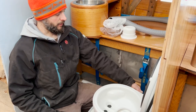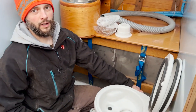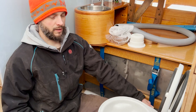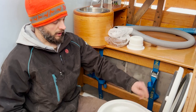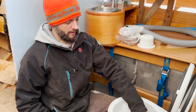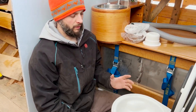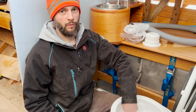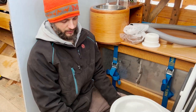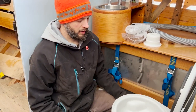And how this works is there's a lever here and it opens or closes a compartment. So if you are equipped with a central hose attached to your body and you want to come and use this bathroom to go number one, you can leave this like this. And if you urinate on here, it gets directed through a gap and it goes into the pee jug. How this head really works is it's separating the liquids from the solids. And if you are to sit, then it ends up going in these forward drains. But no matter how you use it, the idea is the urine goes into the jug that you take out and dispose of. When you open this lever, it opens that trap door, and that's where you want to put your solid waste, in the bucket.